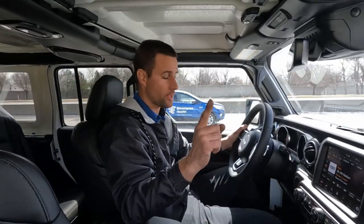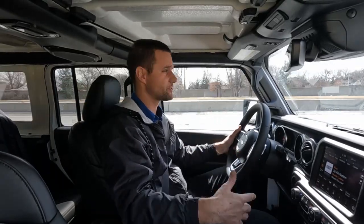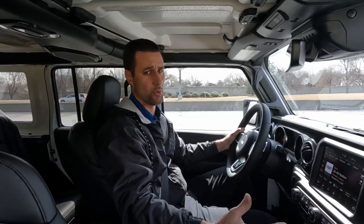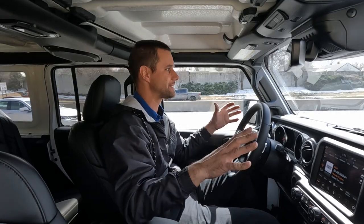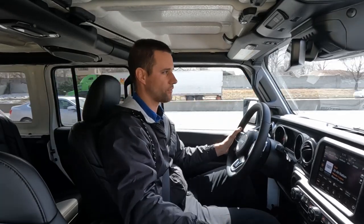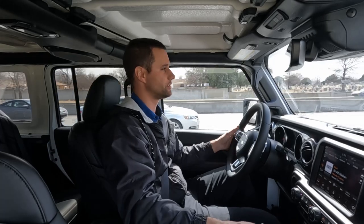If you're looking to get just a tiny bit more clearance, that seems to be a pretty decent setup and it drives fine. I also added Mopar front lower control arms — the ones that come in the Mopar lifts — which add a little more length to the lower control arms, adding caster and making everything drive and ride nicer. It's not that much money for the longer control arms, and getting the caster where you need it is always a good thing in a Jeep or any solid axle vehicle.